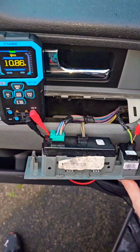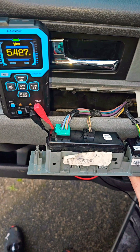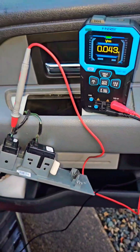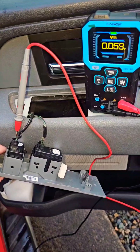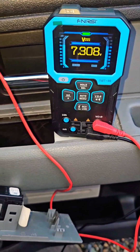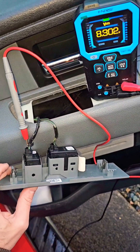Testing the blue wire with green stripe: steady 10 volts. Pressing unlock dropped it to 0.1 volts, then returned to 5 volts; pressing the lock switch returned it to 10 volts. On the passenger door, the yellow purple striped wire maintained a constant 0.04 volts; pressing unlock brought it to negative 0.07 volts. On the passenger door blue green striped wire, pressing unlock showed no decline, but pressing lock declined it to zero volts and returned to 8 volts.